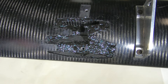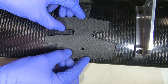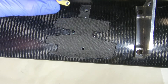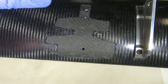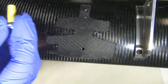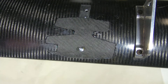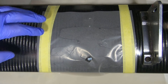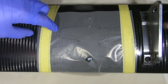What we're going to do now is gently place the top skin on in the correct location and then install a blanking plug so that the screw thread doesn't get any adhesive into it. This is a 5mm or M5 machine screw that's had some masking tape wrapped around the outside of it. The hole in there is M6, so we're actually just going to use this to self-thread in there and form an interference fit inside that hole. I've applied some builder's plastic over the part and we're going to tape over this surface here so that the skin is pulled down flush against the doublers and as close to flush with the original skin as possible.